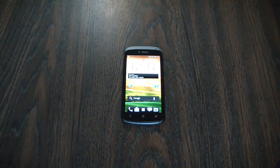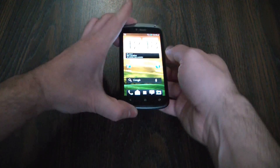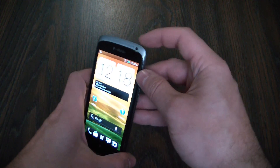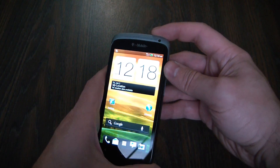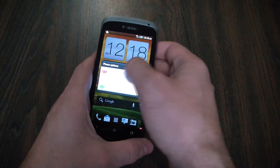In this tutorial I'm going to show you how to hard reset an HTC One S smartphone. The first thing you're going to need to do is to fully power the phone off. Just push and hold down the power button, then select Power off.